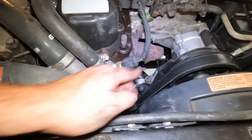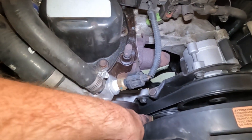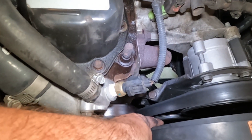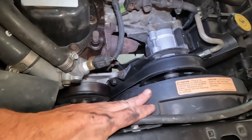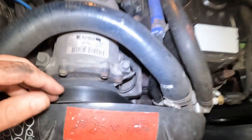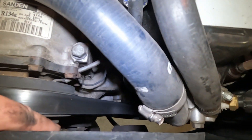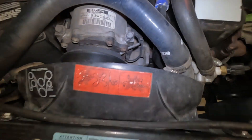To replace the fan clutch I need to remove the shroud and then relieve tension on the belts. But before I can back that off, I've got to get all the way down and loosen the idler pulley bolt. To do that I'm going to have to take the electric fan out first. With the electric fan out, that'll give me access to the fan clutch at the back so I can reach those bolts.